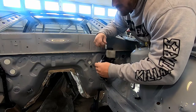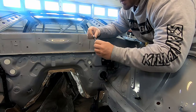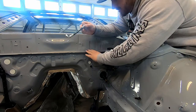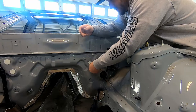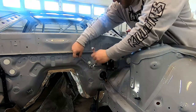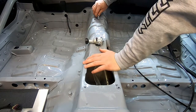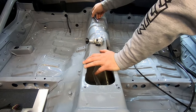I need to start installing some of the brake cables — I went and had some made to replace the other ones. The crimped ones versus the reusable fittings are slightly better in reliability, so I wanted to switch over. Also aesthetically the black looks a little better against the gray. They didn't have all the lines so we can only install a couple for now — they should have the rest done by end of the week. Next I need to install the rear brake bias valve, which is how I adjust braking pressure to the rear — really good for left-foot braking.